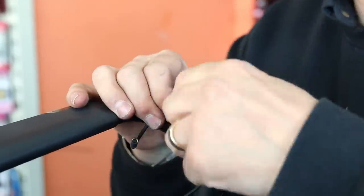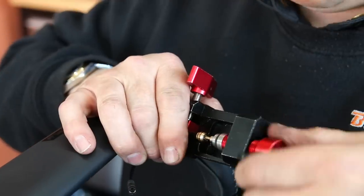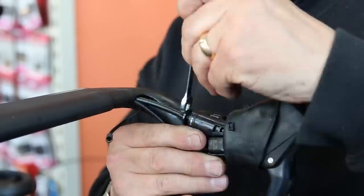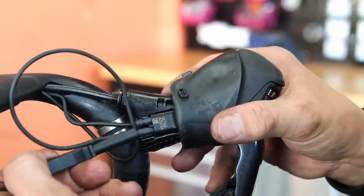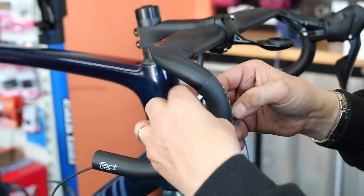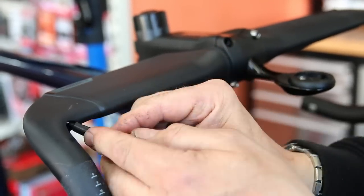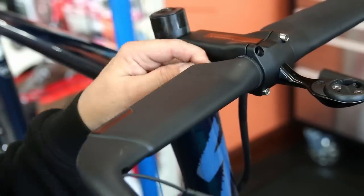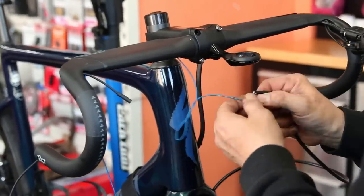On the headstock I've only put two bolts in because these handlebars had to come on and off several times during the process. We're also putting new ferrules and ends on the brake pipes ready for bleeding. Now, this job — just changing the handlebars — looks very straightforward in the video, but this was pretty much a full day's work. It's the 'can you just' jobs that end up being the most time-consuming and problematical.